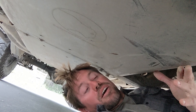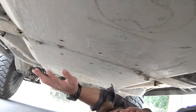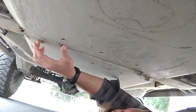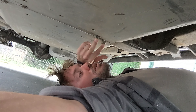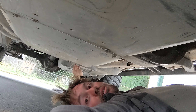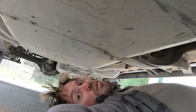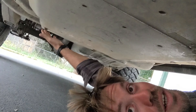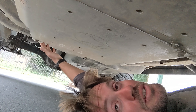I've just climbed underneath the Hummer. These are my first prototyped aluminum skid plates — bolted up just fine, no issues. Starting at the front: you can see the stamped steel skid plate right there, factory bolt coming over here, and there's the other factory bolt. This is the aluminum front skid plate. Coming on back, here and here are two more factory bolts. Line these guys up before you do any drilling. On the driver's side, these two bolts are where you drill the half-inch. Line up as many factory bolts as you can. That bolt — if you live in the rust belt — can be problematic, so take your time.